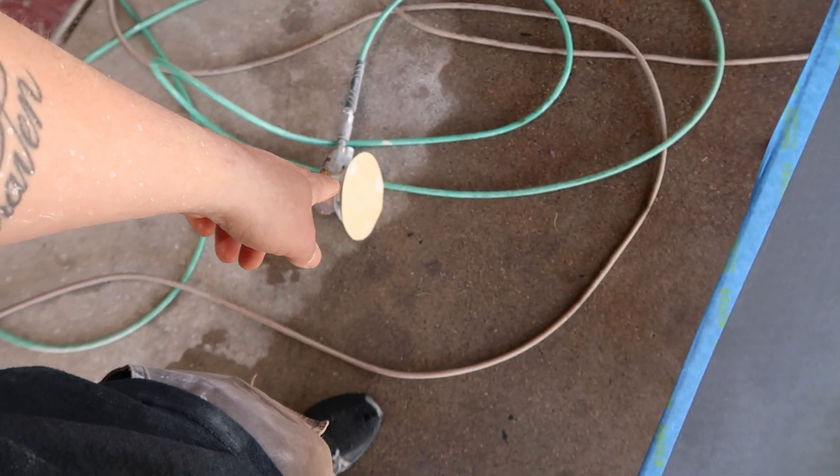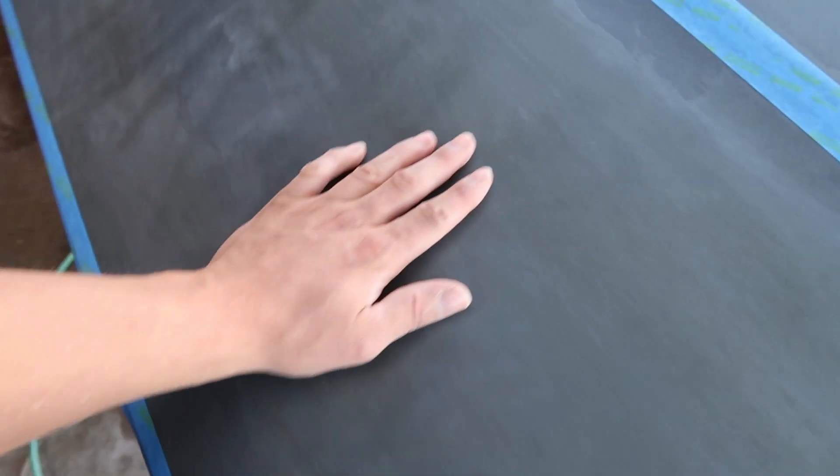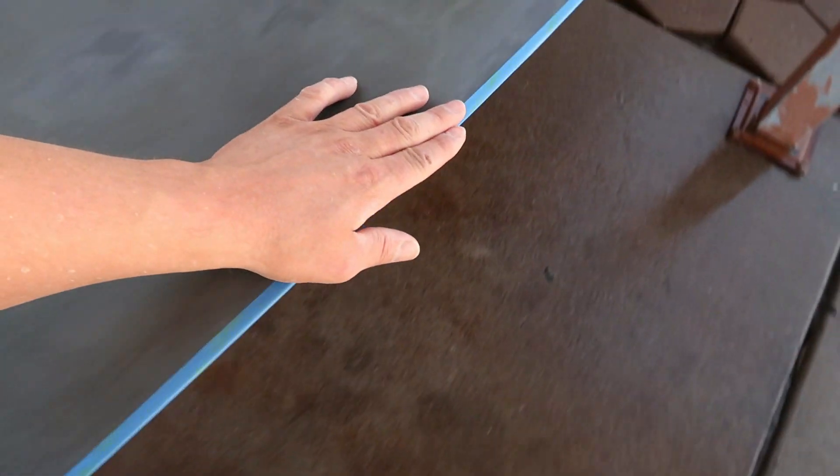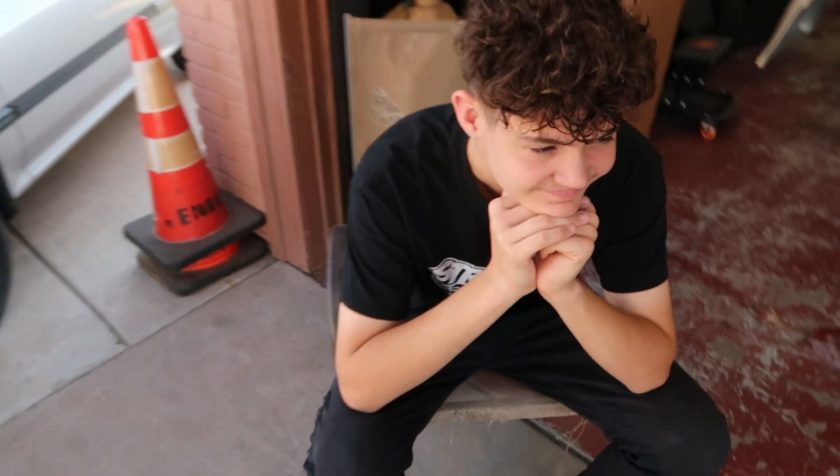I've resorted to using dry sandpaper at 120 grit, which is really scary to use on something like this. But if you take your time and take small layers off - I've gone over this twice with the 120, just skimming over it. You don't want to work a lot in one spot. I've pressure washed it off and dried it to see where I'm at. I have all the dangerous areas taped off - all the edges and the body line.